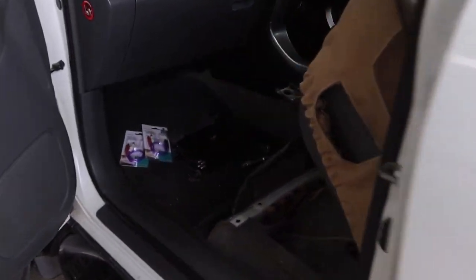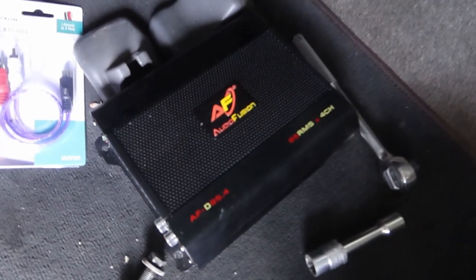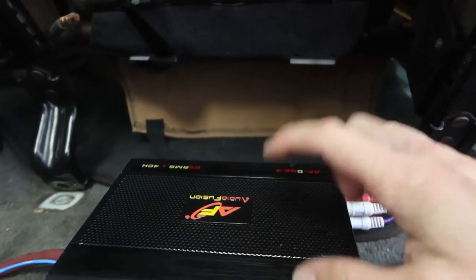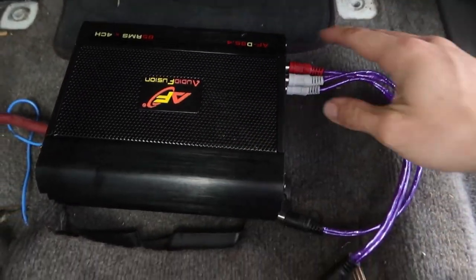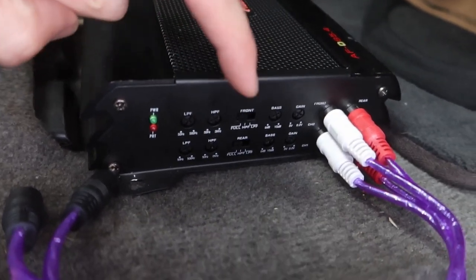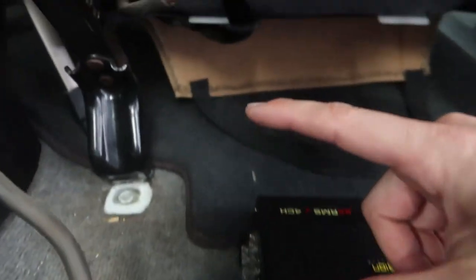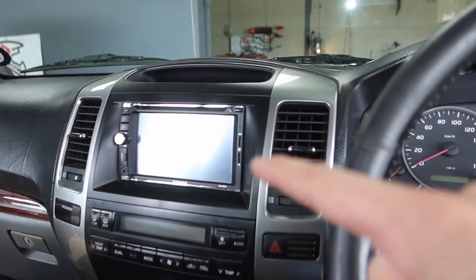All doors now have their speakers fitted. I've managed to pull the seat up and there's our mono block that was in the car - replacing that with the 85-watt RMS per channel four-channel amp. I wasn't the biggest fan of using the big cable ties to hold the amp but with single-sided foam on the back it's holding really well. For wiring, we've got an RCA splitter running all channels into all four inputs, and all tuning will be done on the side of the amp - including the front/rear power balance. On the other side we've got power, remote, and ground.